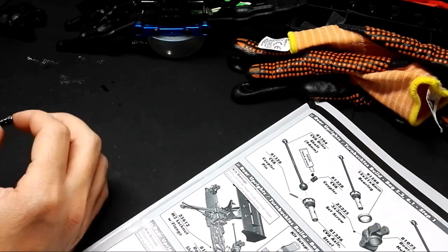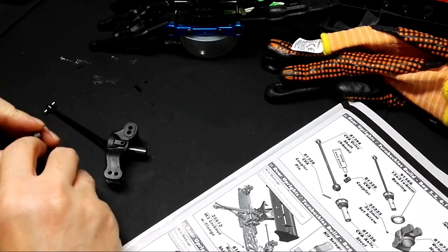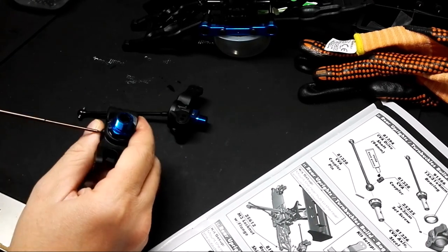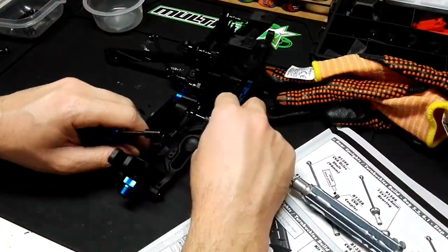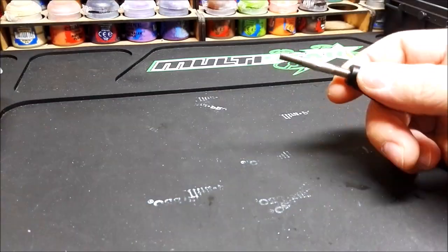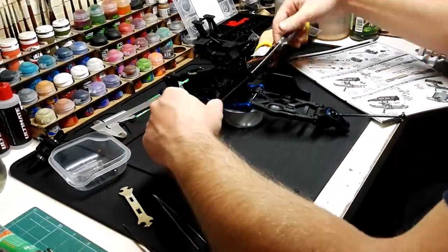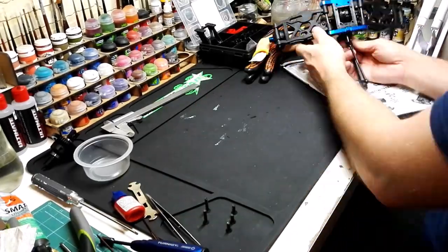At this point in time, I have found only one issue with this rig, which I don't really like, is the fact that in my previous model, which was Carson, all the important and fastest wearing ball bearings were of the same size. By that I mean the ball bearings in wheels and in the differential housing. In Team Associated, all of those ball bearings are of different size, so you have four sizes of ball bearings which you need to have with you on the track all the time, which may make the maintenance a little bit more difficult in the future, but it's not that big of a deal, I believe.